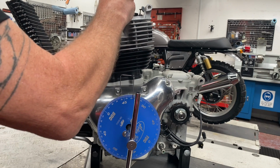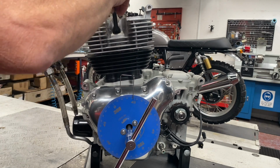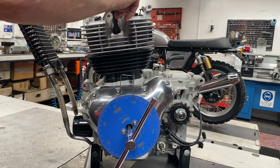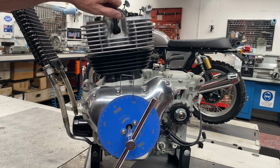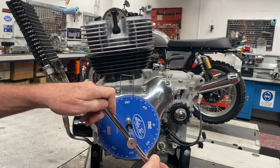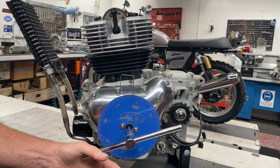First, you want to move the crankshaft to a point where we're confident that the piston's not at the top. Then, install the positive stop. If, as you're putting this in, you start to feel resistance, it's finesse, not force. Don't force it, because you can certainly damage things. Now, with that positive stop all the way down, gently rotate the crankshaft, and it will come up to where the piston touches that positive stop and stop.